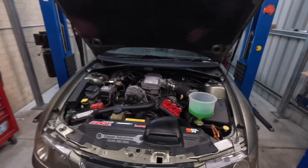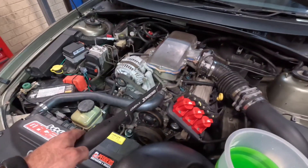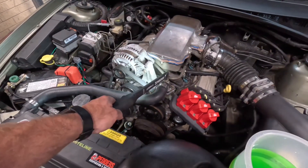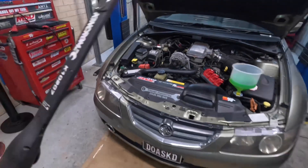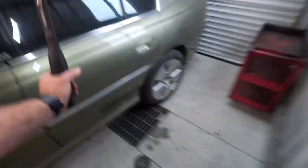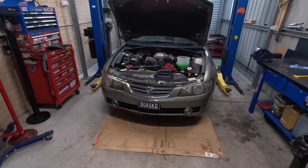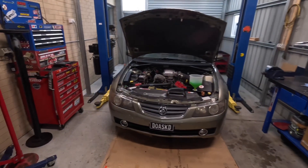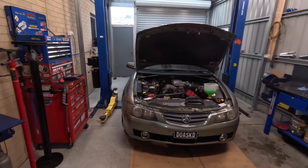The only thing left now is to run it for a while. The reason I drained some coolant out of it before is the thermostat gasket was leaking quite badly - I've gone through and replaced the gasket and also fitted a high-flow thermostat. I filled the coolant up until it came out of the bleeder. I always like to run them for a while and make sure they get up to temp properly, the fan cycles correctly, and with the new ECU and wiring, just make sure everything runs as it should. I've put all the inside back together - the ECU is mounted and the kick panel is back on. Another win: the transmission still does move - I've still got reverse and first gear. It does thump quite hard when you put it in gear, but at least without any wiring connected to the auto it can still get gears, which I need for moving the car around.